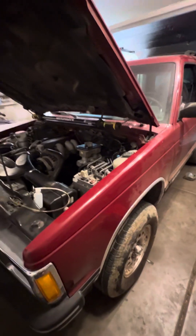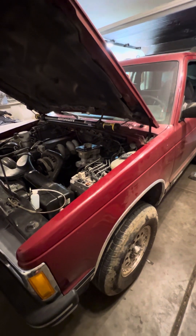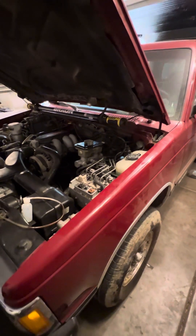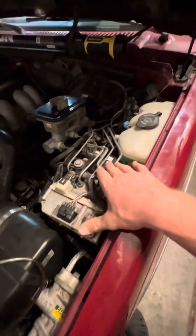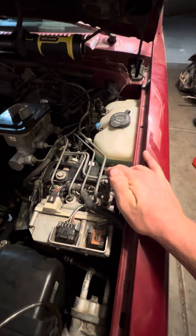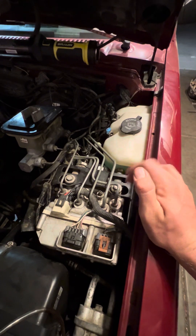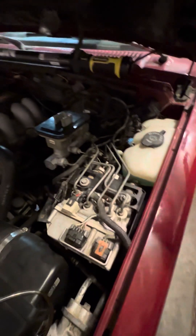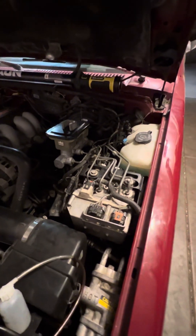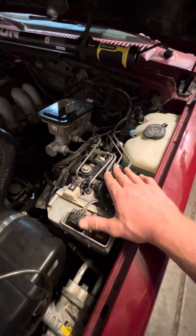What was going on with it was I had the anti-lock warning light and the brake warning light. I also had a super stiff pedal and just kind of felt like I didn't have all my brakes. What ended up being the issue was this module had air trapped in it. Apparently on these, when you got air trapped in the system, there's some sort of safety shutoff valve that disables the ABS. So I was throwing ABS codes left and right. Finally figured it out — it was just air trapped in the system.